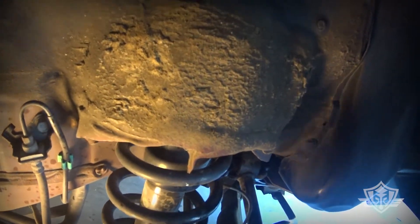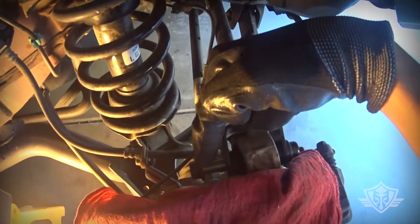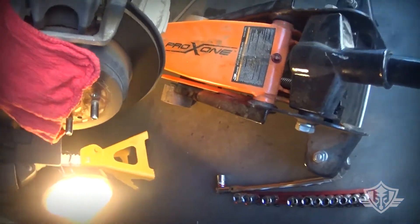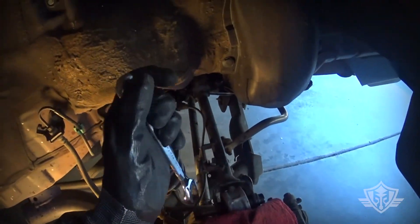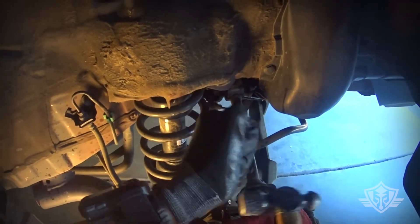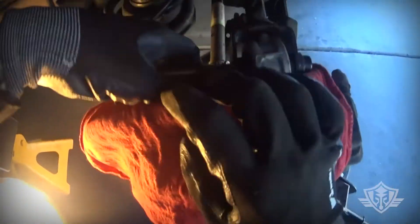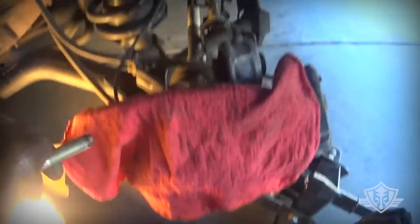This one's got plenty of room for a ratchet so we can go ahead and ratchet that off. You may need to put a crescent wrench in here so you can put a little bit of outward pressure on it while you're ratcheting. This is going to be a little tricky to get out — it helps if you put a little bit of pressure from underneath with your jack. Just use your crescent wrench. It's almost all the way out — it's a little tricky, it's pretty tight. There it goes.